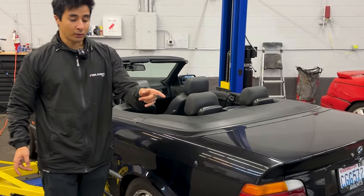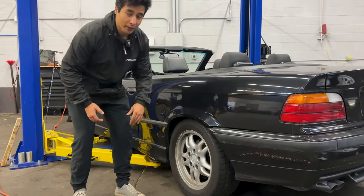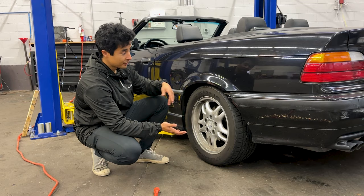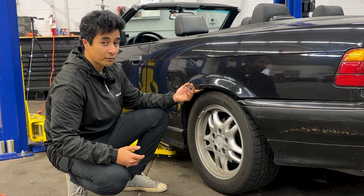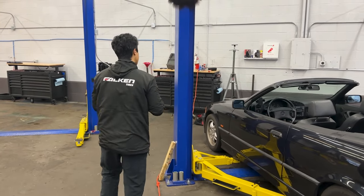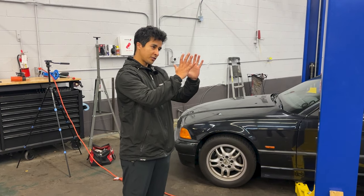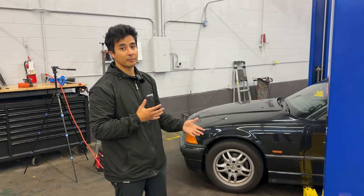The only problem is when you're running a nine-inch wheel on an E36, you're going to run into a lot of fitment issues. With advice from Apex Wheels — huge shout out to them — we got a better glimpse into what it will actually take to run something like this. So these are the original factory 16-inch wheels on here. To get the new wheels to fit we're going to need to roll the fenders, which will alleviate a lot of the issues in the rear. For the fronts, I also have a five-millimeter spacer just in case, because you need the wheel adjusted out slightly so it doesn't come in contact at full lock.